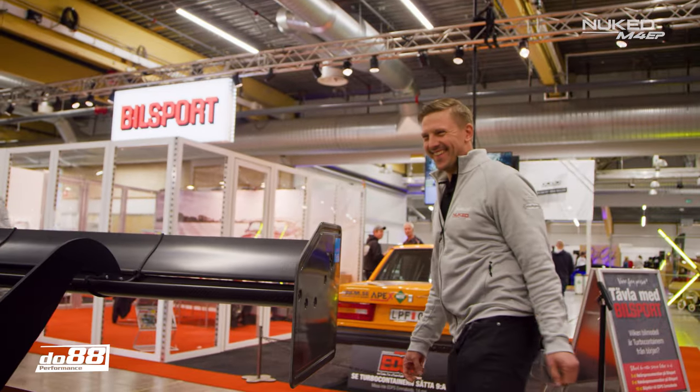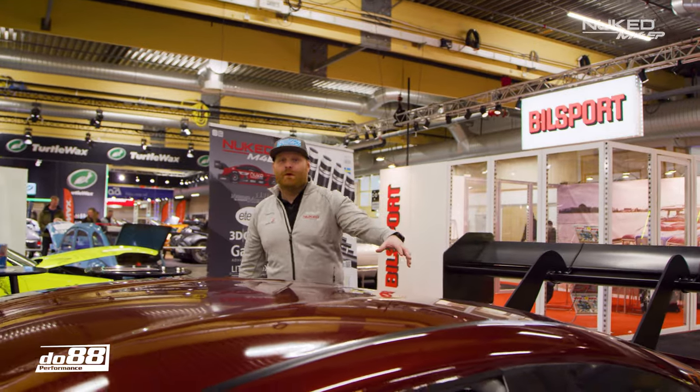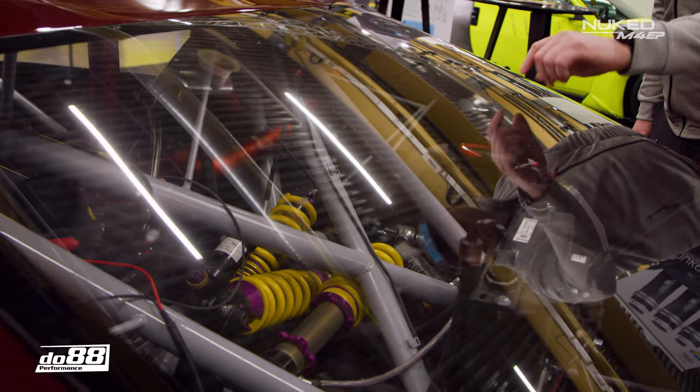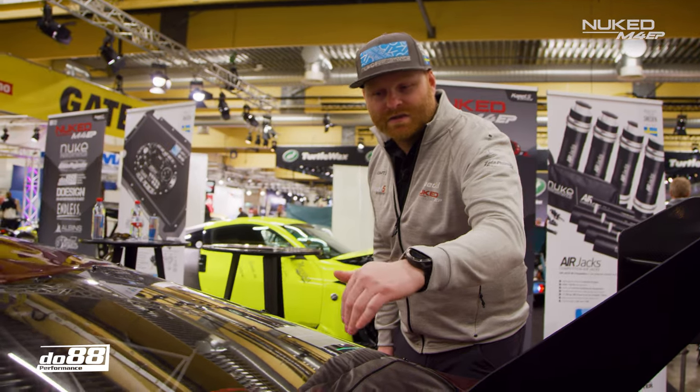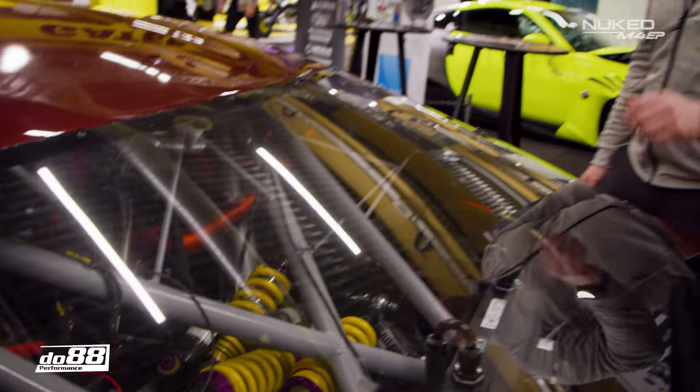Game changer. If you can see also through the back window, come here. This is a special setup. We have a third suspension setup here, which is basically the third element. The damper that's farthest back is the one that will handle the aero parts. Down here, we have also Albins SD6 gearbox with clutch, flywheel, starter motor, alternator. Everything is here in the back.